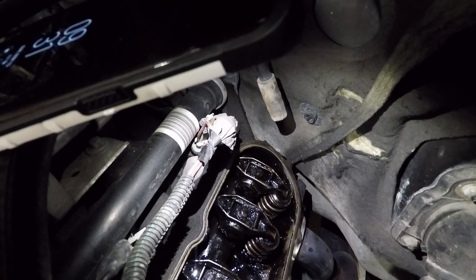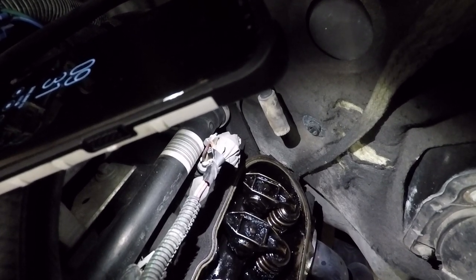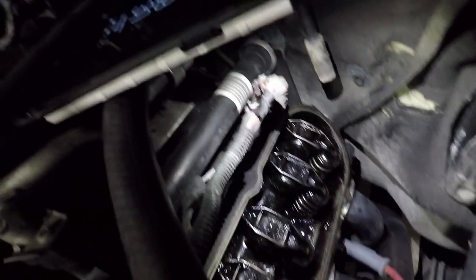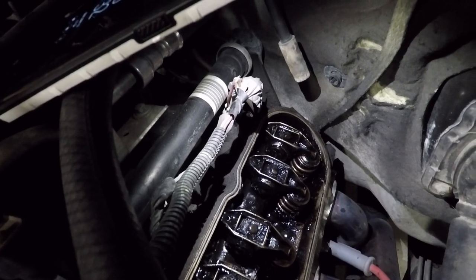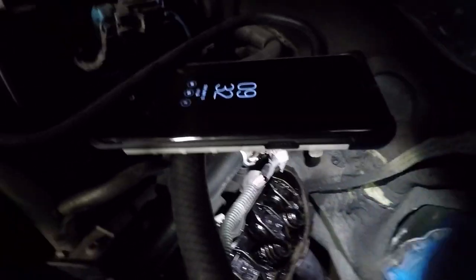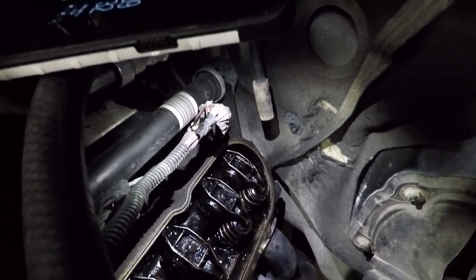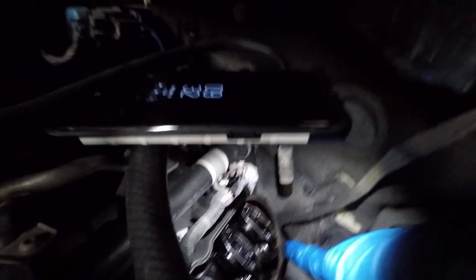I checked it. Some rocker arms have all the movement, others have nothing — it's not loose, there's definitely play there. Right now I would get a new rocker arm, but I don't think I will today. This thing has got a ton of miles and has obviously seen better days. I'm going to rebuild it in the next couple of months anyway — do a cam, probably a new intake setup. That seems to be the problem, and I don't have a spare rocker arm. It's bad because I need this engine to last a little longer — it's not my daily — but I feel horrible driving around like this.